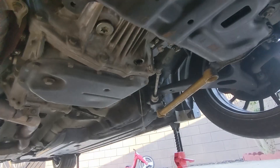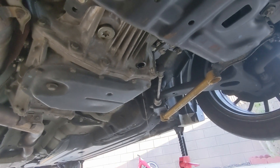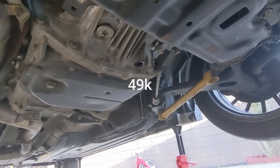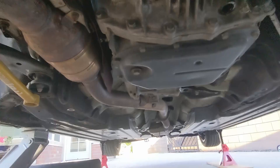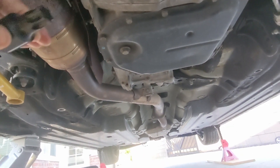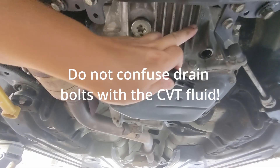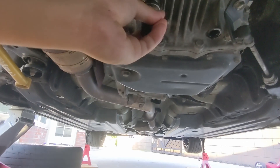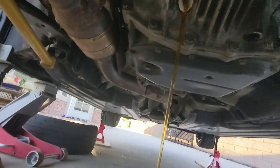This stuff is pretty black from what I can tell. This has never been serviced before — the rear was serviced at 15,000 and then at 40,000, so now I'm at 40,000 and this will be the first time for the front. We've got the drips going there, and now I'm going to be pulling off this drain plug — you'll notice it's the diff one because it says 'diff' right on it, and then it says 'check' over there.